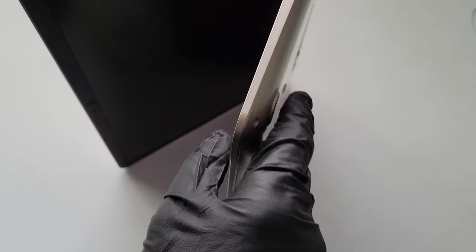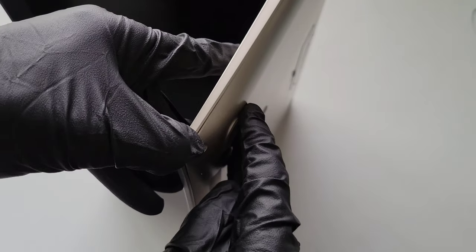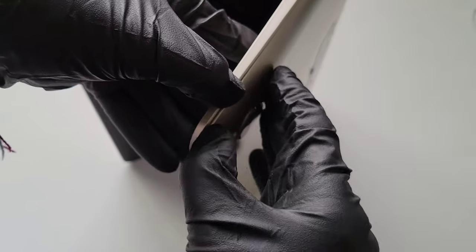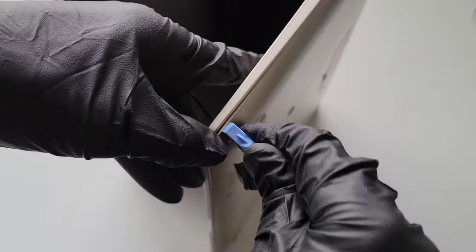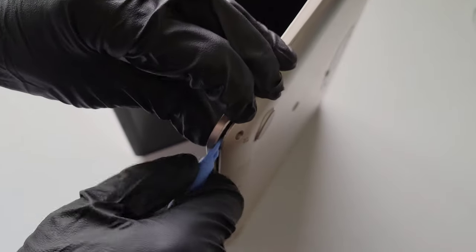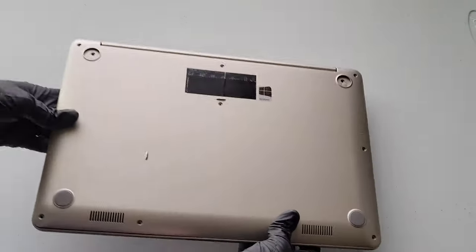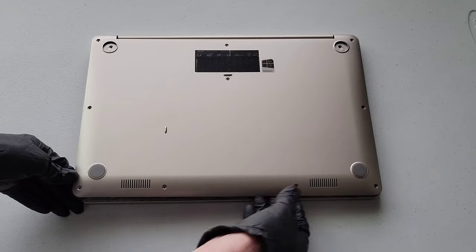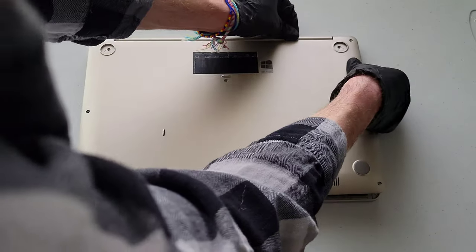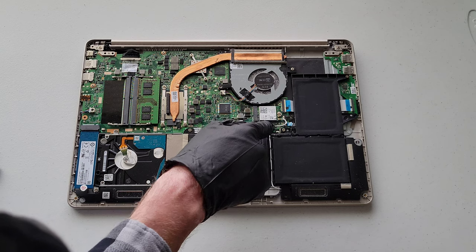Next, I'm going to lift the laptop up, open the screen a little, hold on to the frame of the bottom, and gently pry away the bottom cover until we get it started. I'll use the plastic pry tool to get it started, then shut the laptop screen, lay it back down, and gently work my way around the whole bottom of the laptop until we get the cover off.